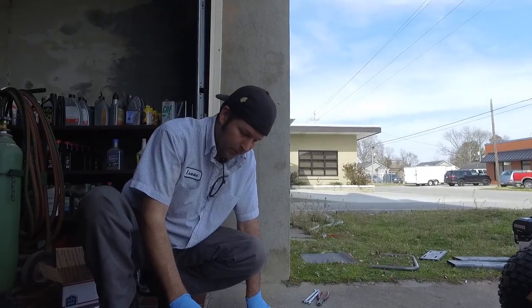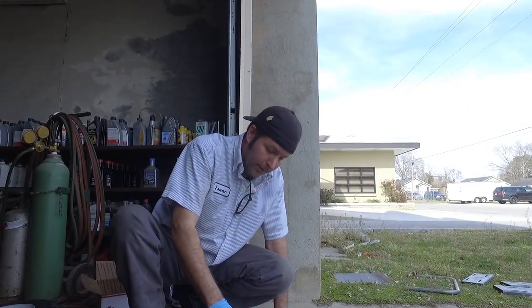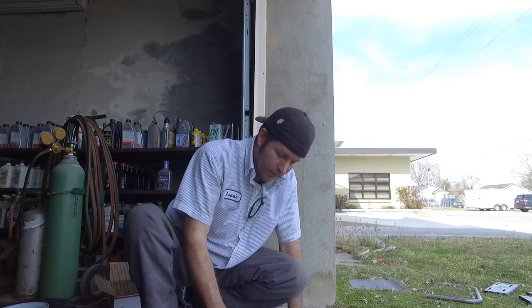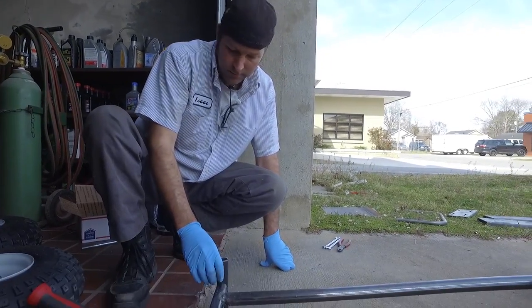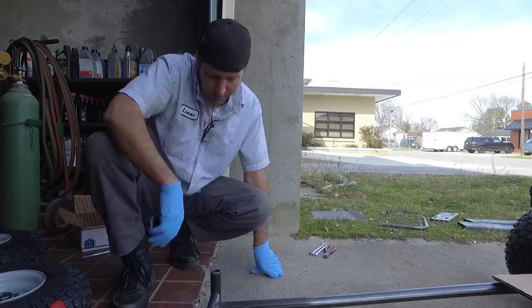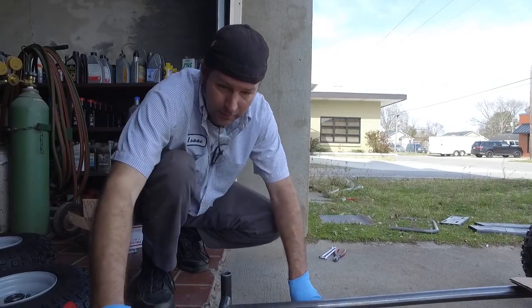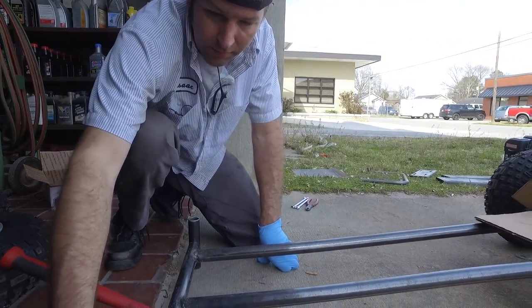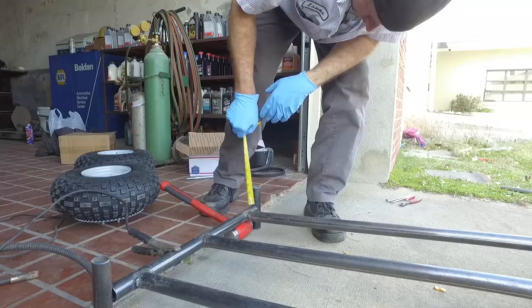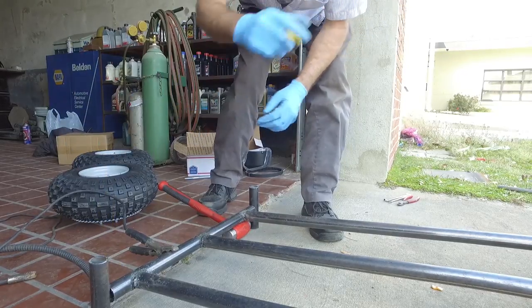Isn't there like two angles we've got to go with for the Ackermann? There's the leaning back and the poking out. So camber and caster? Yeah. I don't know buddy. Let's just weld it. We're just going straight up and down? Actually no, because I've got the front down a little bit. So it's going to have just the tiniest bit of angle — about two and a half degrees.